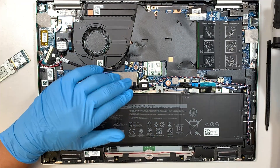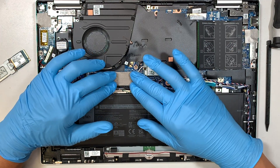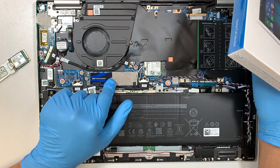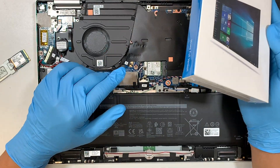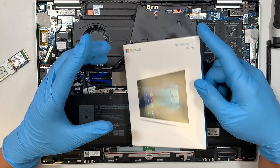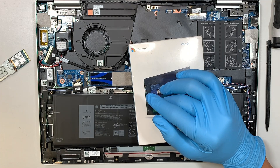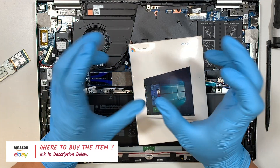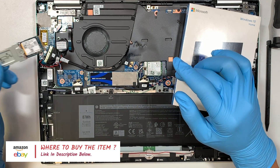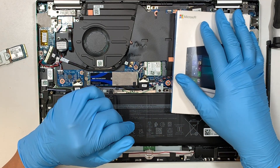Flip the little plastic cover back on and make sure it's securely fastened over the hard drive. As I mentioned earlier, if you install a brand new M.2 drive the computer won't have Windows and won't boot, so you need to install Windows 10 or 11. There's also a USB adapter you can use to transfer data — I'll link it in the description below — and a link to a video on how to clone your old drive to the new one, including the tools and software you'll need.